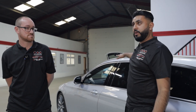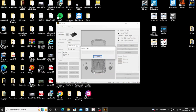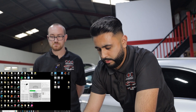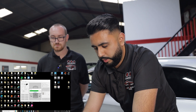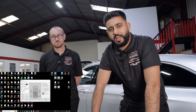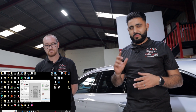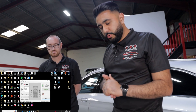Now it's time to tune the system. We're using a product called BitTune. We've set up microphones inside the vehicle — five on the driver's seat and one down the middle. How it works is it plays the speakers a variety of different frequencies simultaneously and adjusts all the imperfections to bring the response as close as possible to what's called a flat response. The BitTune software has done its thing, but that's only an electronic tune — let's jump in, have a listen, and add a little bit of spice to it.